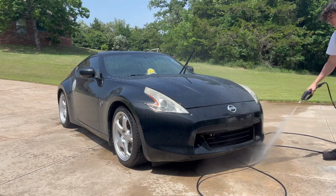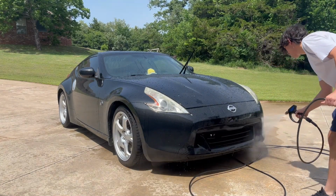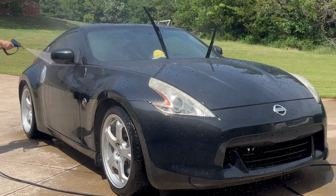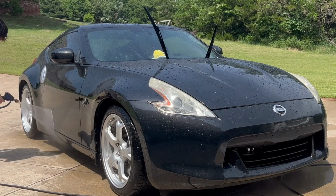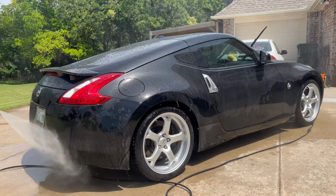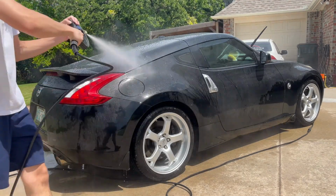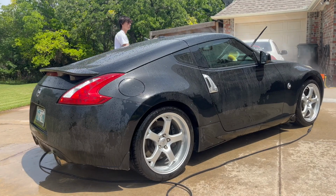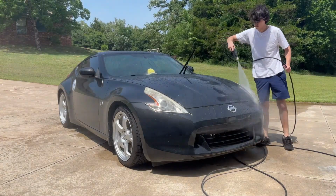So I wanted to give you guys some time with that satisfying wheel cleaning and all that editing and all. So we always start with the wheels first because just the logic through that process, it works. If you're cleaning your wheels after you clean the paint, that dirt will just be slinging all over your clean paint. So we start with the wheels and then I move on to spraying down the car, and in direct sunlight like I am right here, with black paint especially, I do it for probably like 10 minutes, honestly, just to try and cool down the paint a little bit.